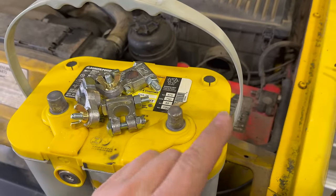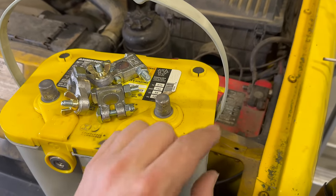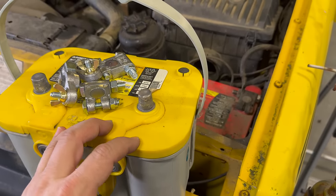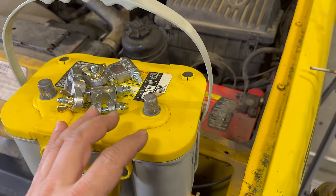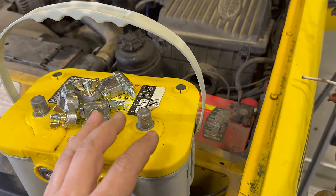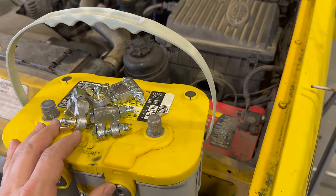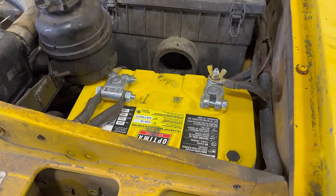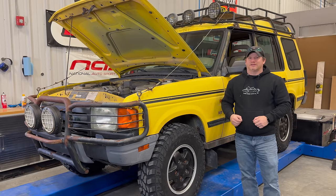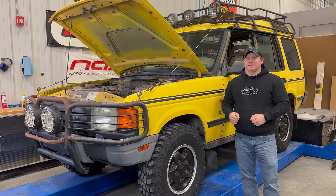I bought a bunch of battery terminals to replace all these bad ones, and I'm going to throw a yellow top Optima in here instead of this old red top. For one, this one's ruined and isn't going to come back. Two, a yellow top is a deep cycle battery — meant to be discharged and not charged all the time — so I can charge it and keep it disconnected for emergency purposes. The yellow top battery is in, I have the new terminals on, and this is looking a lot better. That was a lot of fun — I've been waiting to mess with that dual battery system ever since I picked up this truck, and it's taken me eight months to get to this point. I hope you've enjoyed this video — there are plenty more electrical problems with this Land Rover, so if you want to see more videos like this, comment below and click subscribe.